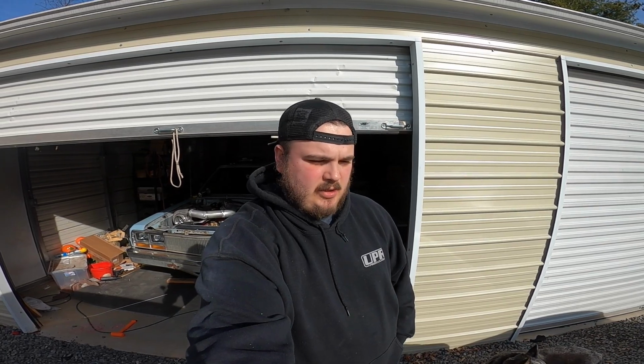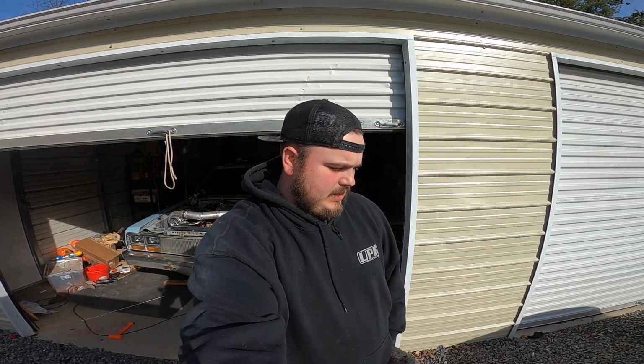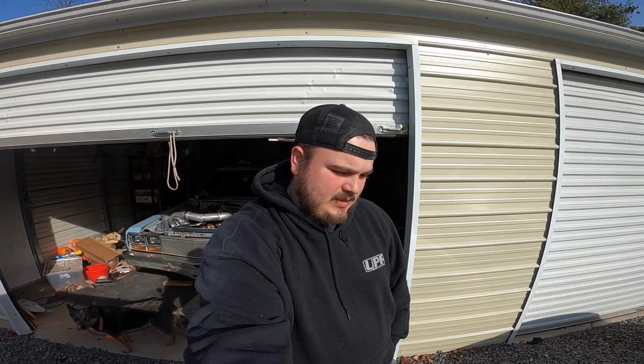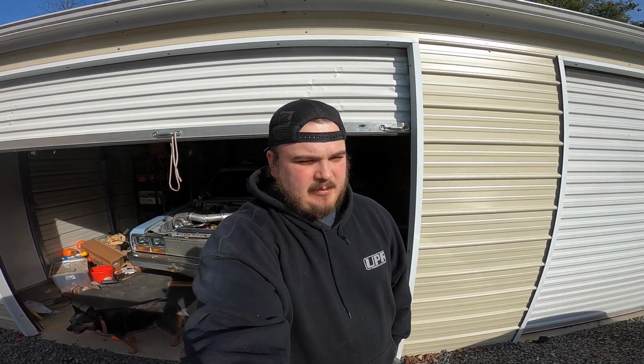I now have a new flex plate on the way and a new block plate, all brand new stuff, which means I have to pull the transmission out and pull the flex plate off of the flywheel. I was pretty frustrated last night whenever I found all that information out. It's unfortunate. I thought I would be bringing you guys a startup video, and instead I am bringing you three steps back again.